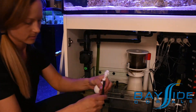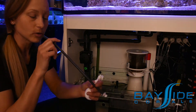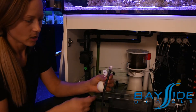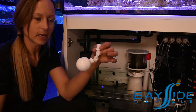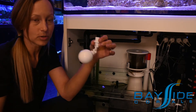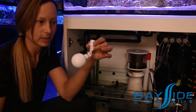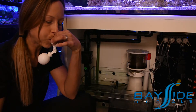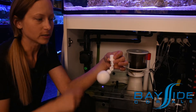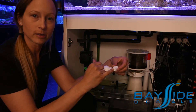Now what we can do — we'll take this hose and blow through it. You should be able to blow through that one very easily. So that's not plugged. When it's hanging in there and it's down, that's when the water should be allowed to go through, so you should be able to blow through it when you hold it in this position. Ours isn't plugged, but if yours is plugged, it may be plugged in this small hole in the end here.